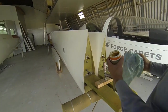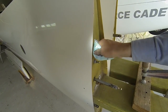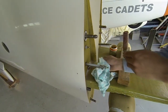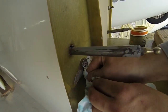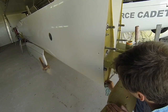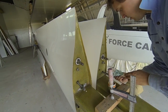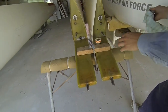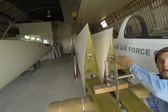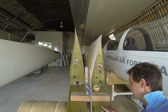These are exactly as they've been de-rigged, so you can see all the old remnant grease in here. All we want to do is give everything a good clean. Just give it a clean, getting the remnant grease off all the fittings - and we've got the water ballast one here as well. Every time you rig it you've got to pop your grease on there. It's especially important if you've outlanded and de-rigged and put it in the trailer - dust gets everywhere. Always a good practice to clean and grease whenever you're rigging or de-rigging.